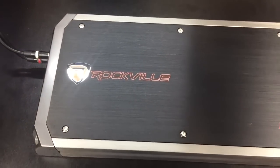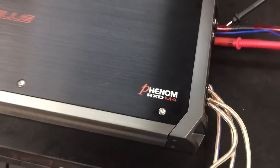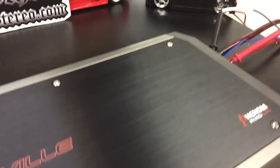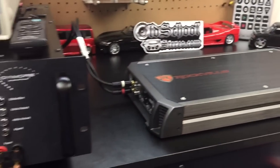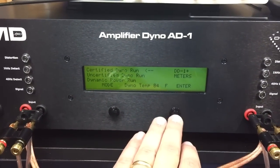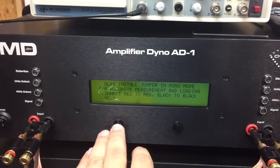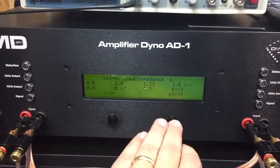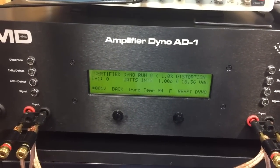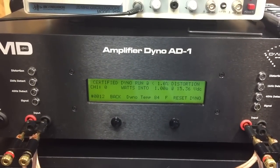What's up guys, BigDWiz here in the old school stereo labs with a new amp — we got a Rockville Phenom RXD M4. I'm going to try this bad boy out on the dyno. It says it does 1500 watts RMS at 1 ohm, or 3000 RMS — 1500 CEA. Our test simulates CEA ratings, so we expect to get 1500 watts at 1 ohm mono, doing a 40 hertz track. We're giving it quite a bit of voltage, should end up right around 14.4 or so. Let's see 1500 watts, baby.